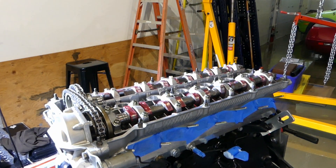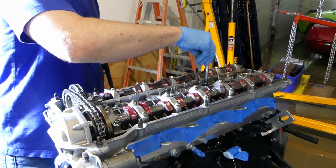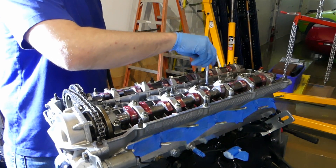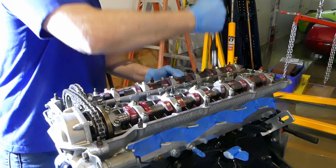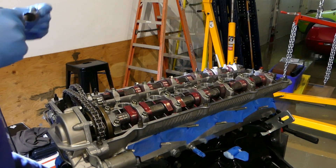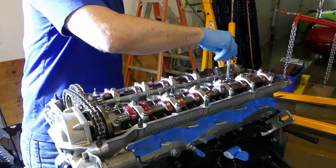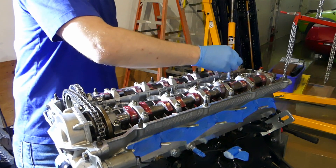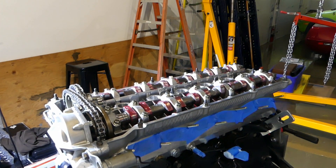The manufacturer's recommendation for 100,000-mile spark plug changes is actually not bad. When this engine was first delivered in '98, it came with copper electrode plugs good for at most 30,000 miles. I went through a few sets of those before BMW superseded them and started recommending Platinums. These are almost like aircraft spark plugs — about $22 a piece — so there's no point in replacing them with that much life left in them.